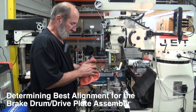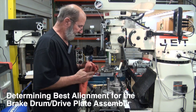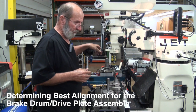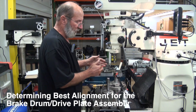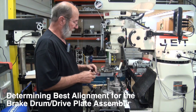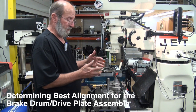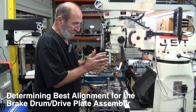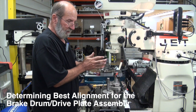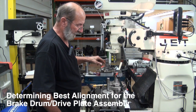My experience has been, and I do a lot of transmissions, so my experience has been to try to come up with some way that I could do this task of getting these two components, the brake drum and the drive plate, centered up. We've went through a process on the lathe cutting the companion flanges down so everything is square and flush, and so when we put it together we stand a chance of having the least amount of run out we can get from this end to the fourth main end.